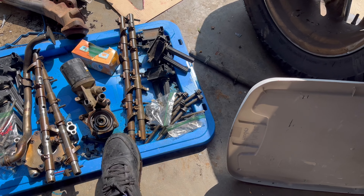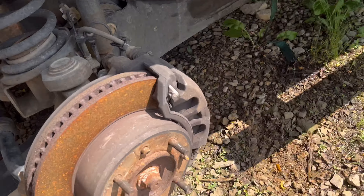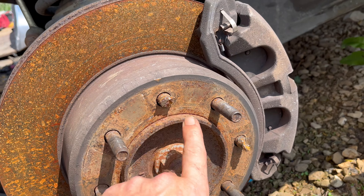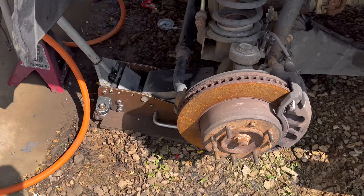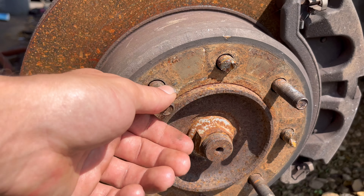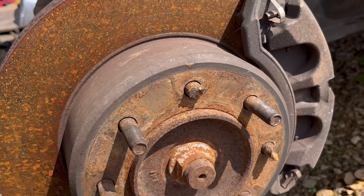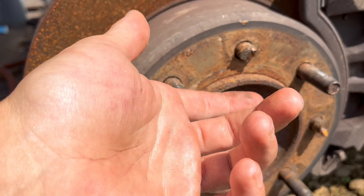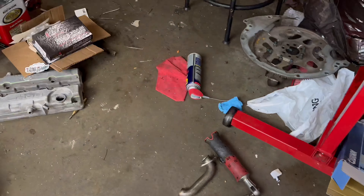I've also gotta get the gasket for the oil filter housing. I had to drill these studs out, which took a couple hours - that was the only way I could think of to get the acorn nut off without messing up the rim. I center-punched the stud itself and just drilled through it. I kept drilling until I was past the acorn, and when the acorn finally came loose I stopped. It didn't just fall off - I had to go underneath the truck and kick and nudge it off.